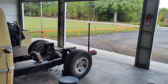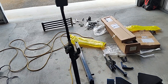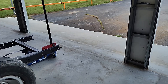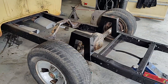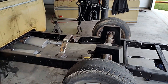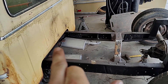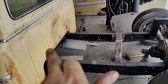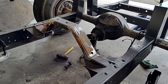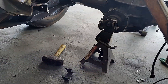Alright guys, we've got a mess going on. The four-link setup came in. We got that all apart trying to figure it out — this is my first time doing it. Got the rear end in here, everything's setting good. I actually had to build a little arch hump right there because our drive shaft going through was going to hit, and it looks like it's probably going to hit up in there too. But that turned out alright — just had to build a little arch hump there. Drive shaft will go right through perfectly now.